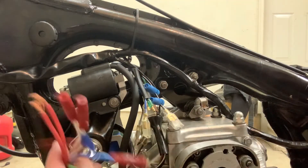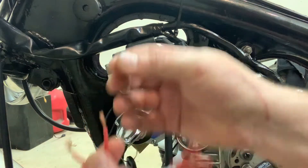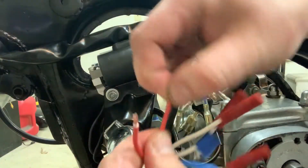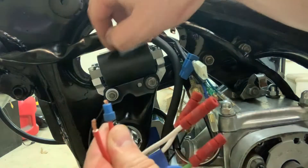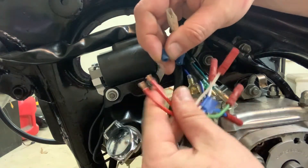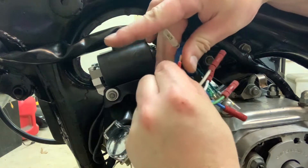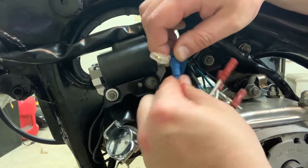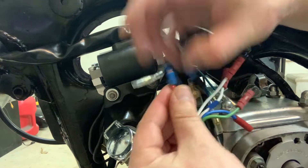We're going to look at our bundle coming off of the shockwave. We're going to be focusing on the two red ones here. I got a little carried away with my wire strippers, so I need to trim these up just a little bit. We've got our wires all trimmed up. We're going to grab the other ends of our Posi-Lock — you just want a little bit of copper showing through the top edge of it. Then we're going to tap this all together into those blue ones we just put into place. Keep a little upward pressure on the wire as you get it going in. Make sure it doesn't separate, and you should be able to just tighten this on. Give it a nice crank, and we'll do the same thing to this one.